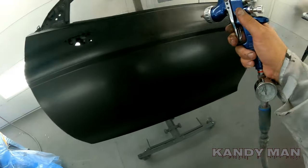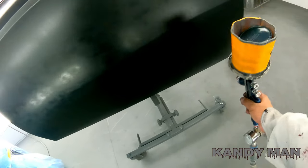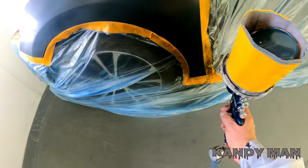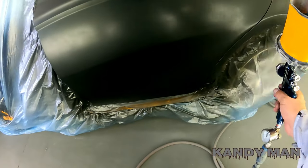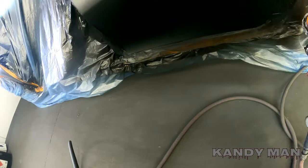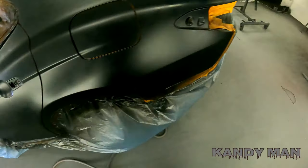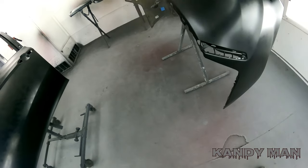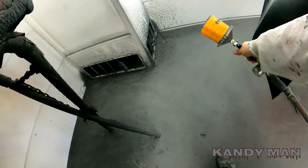I'm not too worried about this color being blotchy, so I'm putting it on a little wetter than I normally would. By the time I throw the blowers on I'll be ready to clear. This gun is awesome for base coat. When I first got it I was having a little trouble with metallics and silvers like 636R. I'd do double back coats and then two to three drop coats — silvers sometimes don't cover well, so check coverage with the light off and a flashlight. I match my sealer close to the silver shade, not too dark and not too light. The gun did phenomenal on the silvers, so it's definitely my silver gun.